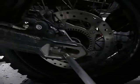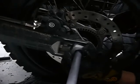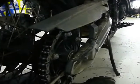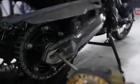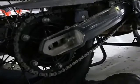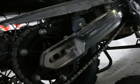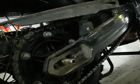Roll the chain on. Move that up there. Spacer on this side. Wiggle that around there until you find the right bit. Okay, get that lined up there. Well, on this side is a spacer. You have to see that it is there. See that spacer? You're just pushing that into its place. It's just catching just on the bottom side there. Okay. Up. Yep. There we go. Just getting the fit down there. Get the axle hole up. Line it up on each side and, like a push bike, it's a spanner one way and a spanner the other way.